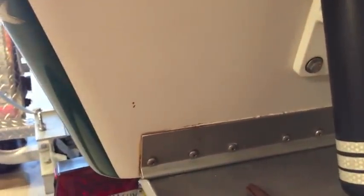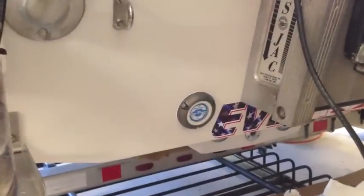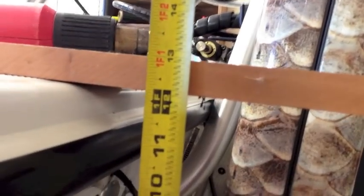When I'm at rest it should illuminate the water out around the edge here really nicely, and then this other light will illuminate the rest. I think we have enough of a spread where the light will converge and be spread evenly across the transom. I measured and re-measured off of the board — it was a little over 14 inches before the shelf, and when I bring the tape measure down level with the hole I'm at right around 12 inches, so I will absolutely be safe. I'm going to drill at an upward and inward angle to make sure those wires clear anything inside. It came through exactly where we wanted it, right there on the transom.